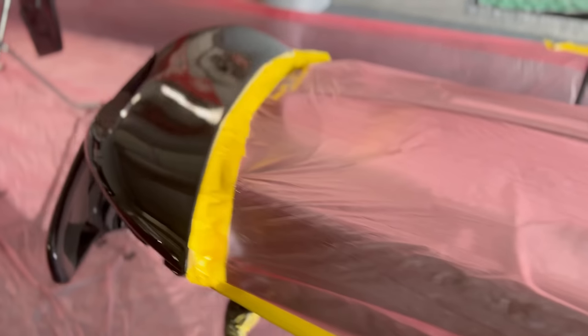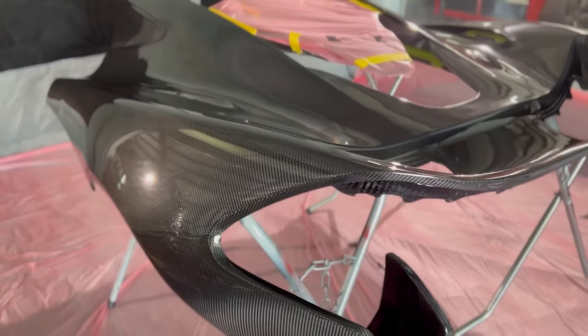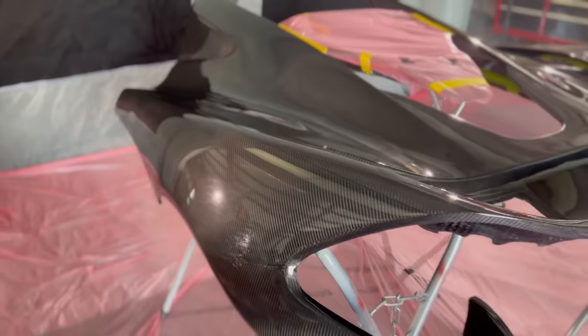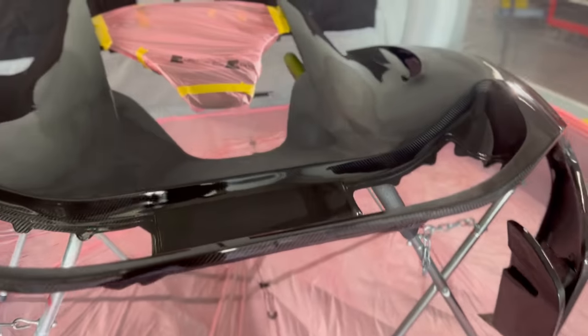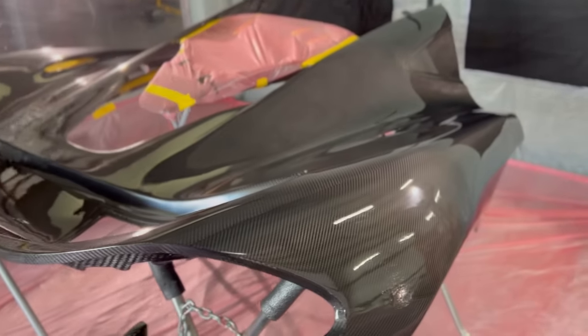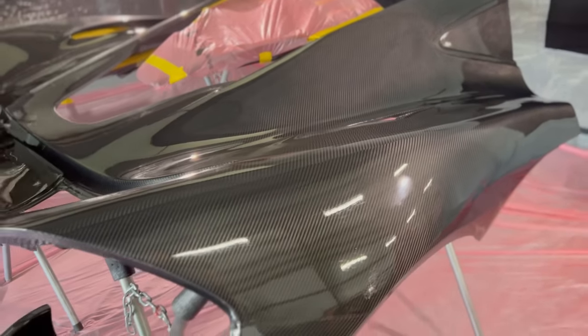And after 3 wet coats, they are looking really good. The rear pan, however, is going to require a lot more work. Although it looks great on camera, it's still got some waves to the side and around the curvature. It will need a more extensive blocking. So we will be coming back to sand it all down, and we have some more surprises on the way.